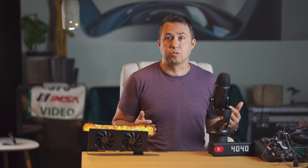Big graphics cards are loud, especially when they're working really hard. Mining cryptocurrencies causes your graphics cards to work really hard. These two little fans have the unrelenting job of circulating air through a heatsink, to pull as much heat up and off of this card as they can forever and ever. As the air heats up in whatever room these guys live in, the fans will go ever faster and therefore even louder. Heat is the thing that will kill your GPUs the fastest, or at least it's what's going to slow down your cards when you're trying to get your overclock just right.